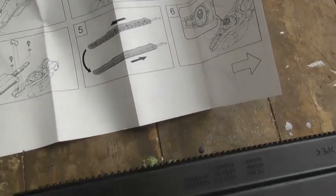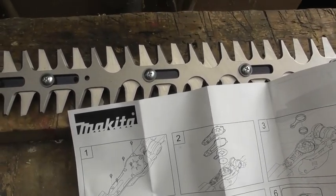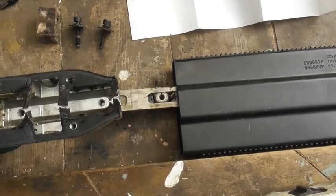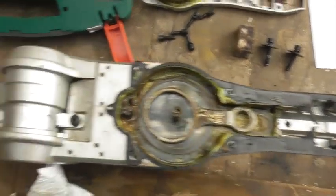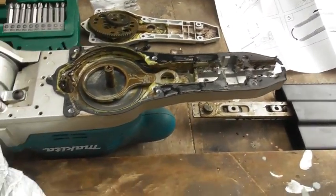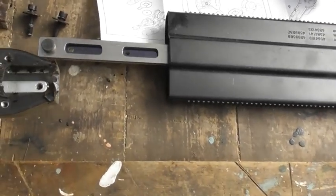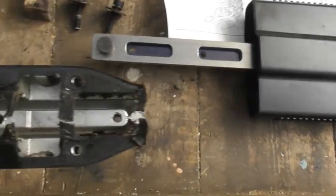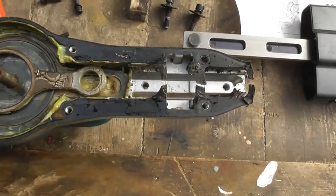I think the idea is — there's this clever little diagram here which shows the cover coming off — but the cover comes off the old blade and now goes on to the new blade, which we've kindly put previously upside down, by the way we're working from the bottom of the hedge trimmer. That's where the motor is under there, just so you know. We've now taken the cover off the old blade and put it onto the new blade, just leaving exposed the bit that has to be fitted into here. So that then protects your fingers from the blade, which is a good idea.